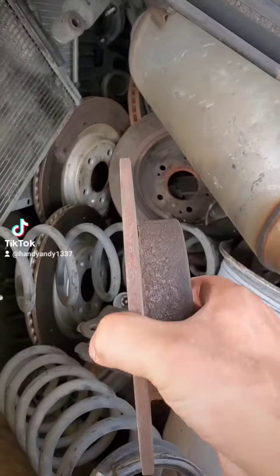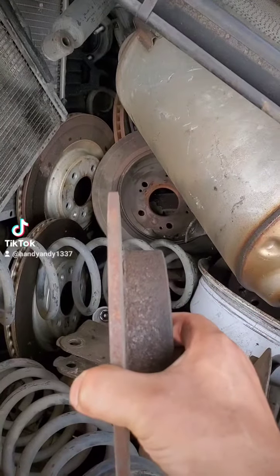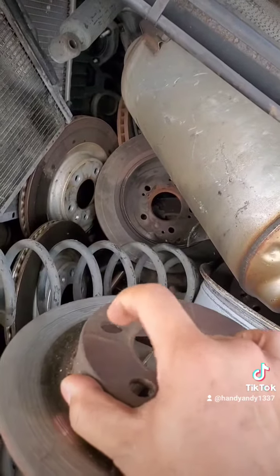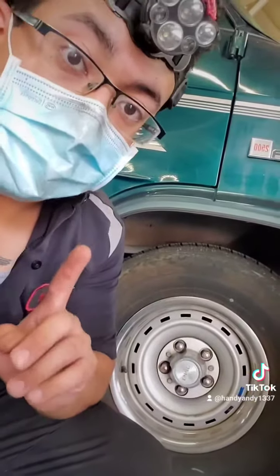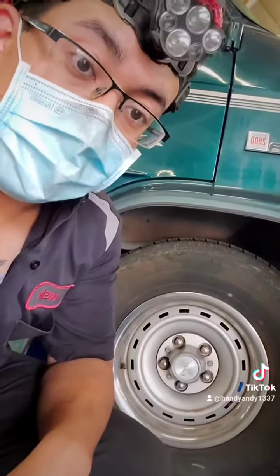With even pressure, your brake rotors will turn true through the actual hub. Uneven lug pressure can cause vibration back and forth between the hub, the wheel, and where the lug nut seats — or just completely cant it, and you'll never be able to see it. You probably won't even feel it for the first few thousand miles. That's also one of the reasons why they say to torque your wheel on in a star pattern. That one simple oversight can cost you quite a bit of money in brakes.